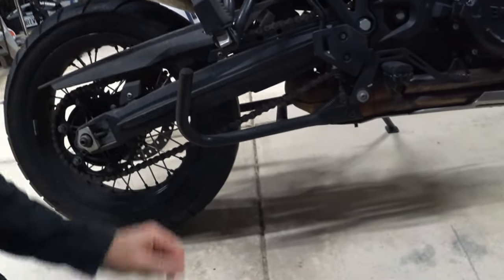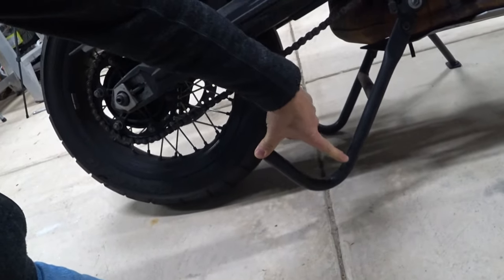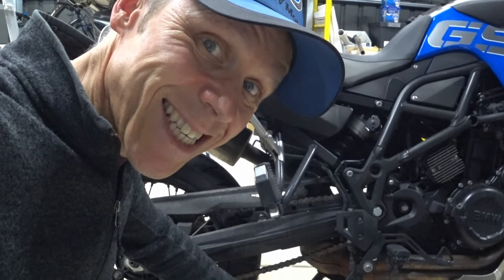Third: you see your stand? You've got a radius on both sides - one there, one there. They both need to be touching the ground before you start trying to put the bike up onto its centre stand. I'll show you. That's your radius there on either side of your centre stand legs. That's where it needs to be.